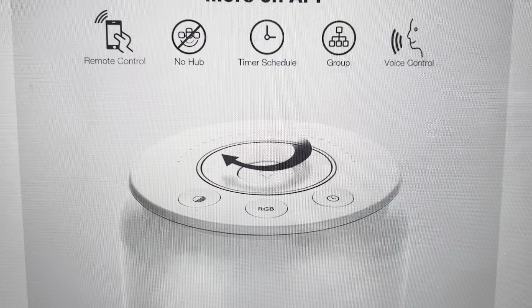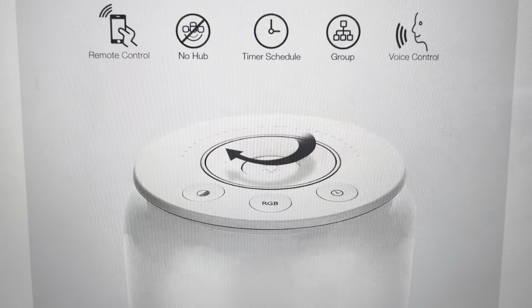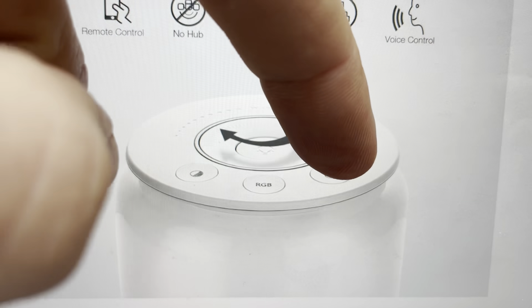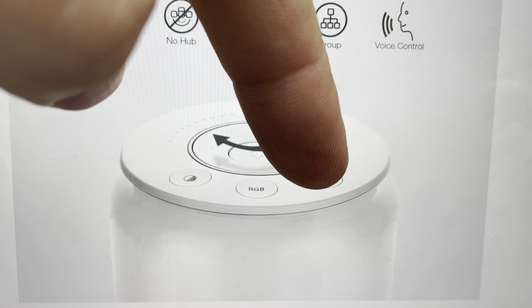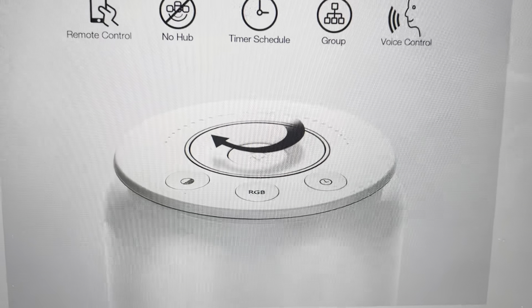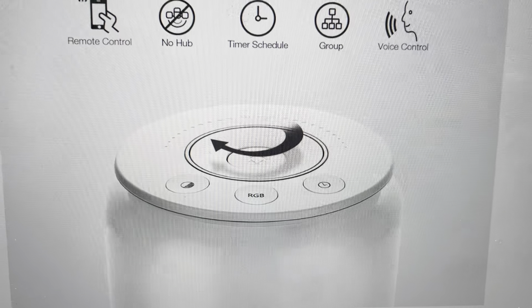All we need to do is start with turning the lamp on, making sure the lamp is on and it's been on for at least 10 seconds. Once it's been on for at least 10 seconds, we're just going to come over to this right button over here, the little clock button icon. I'm just going to press and hold that button for five seconds. After about five seconds, the lamp will blink and it will go through a reset process, at which point it will be fully reset to factory default settings. And you can go ahead and set the lamp up again with whatever apps, devices, et cetera, you would like.